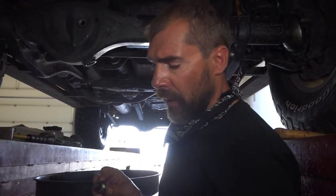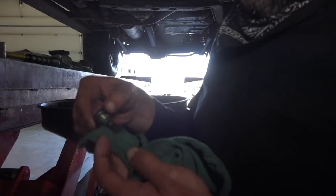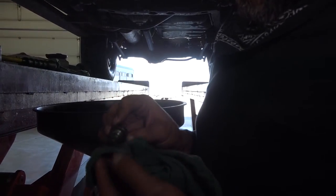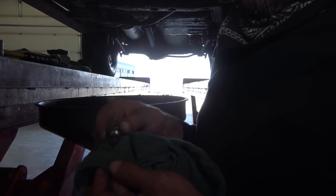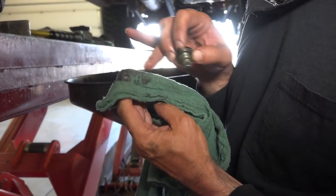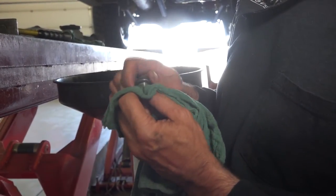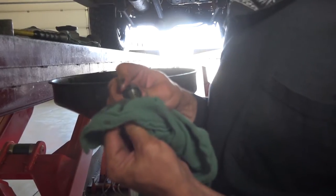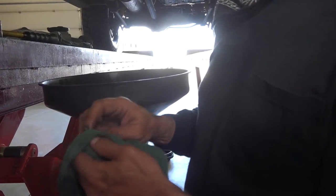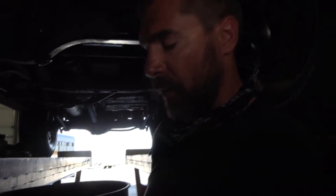The tip of the plug has a magnetic tip, so you will have all this sludge. Sludge is perfectly fine — it's basically very fine metal shavings with gear oil. When it's looking like a paste, it's fine — it's normal wear and tear. If there are any bigger chunks of metal, that indicates too much slack in the ring and pinion or some other wearing problems.